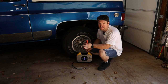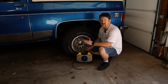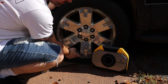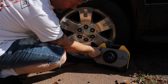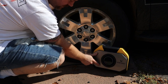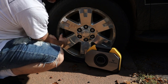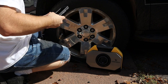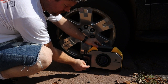Now I'm going to move to a more modern-style car tire and totally deflate it, timing how long it takes to air up one 20-inch SUV tire. I got the tire mostly low — I didn't want it completely on the rim because that can hurt the tire, and this is my personal vehicle. I don't really want to buy tires. Turn the unit on — I already got it set to the vehicle preset of 35 PSI. We're going to plug this in. There's only 4.6 pounds in there. Timer set up — start.